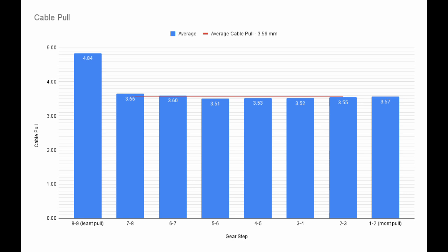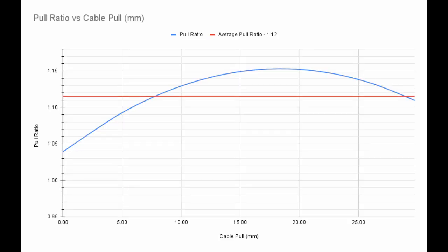You can now use this number to find other shifters that could work in place of this one. I've taken the middle six shifter steps and created the pull ratio curve for a derailleur that would best match a 9-speed link glide cassette with an average cog pitch of 4.05mm. Here we see the pull ratio curve, and we can observe that it has an average pull ratio of 1.12, represented by the red line. We can use this pull ratio of 1.12 to find derailleurs that could be compatible with this shifter.